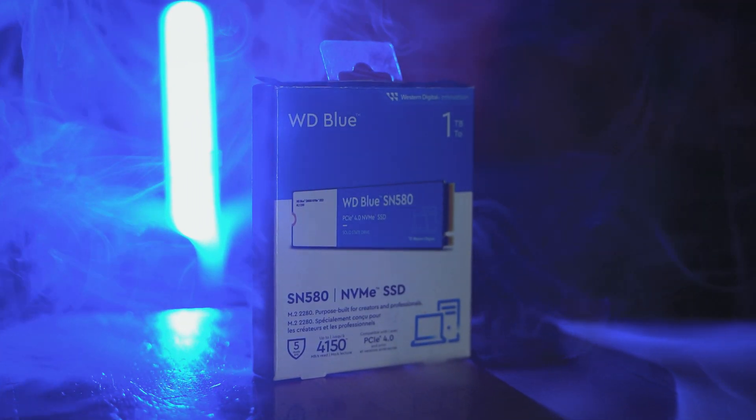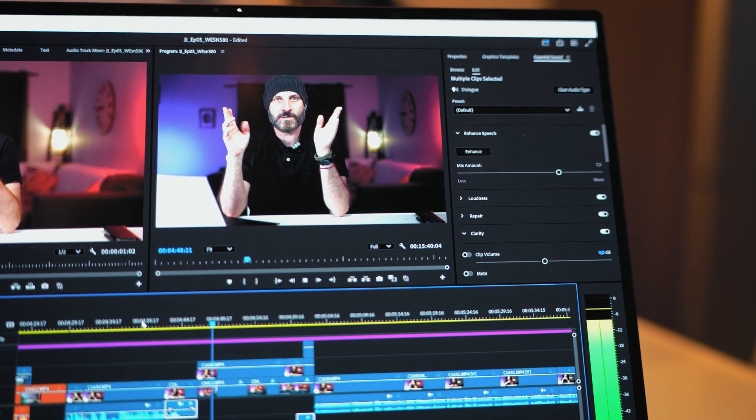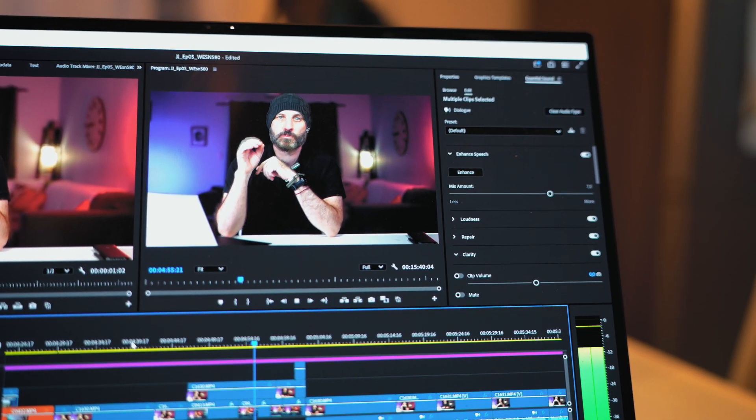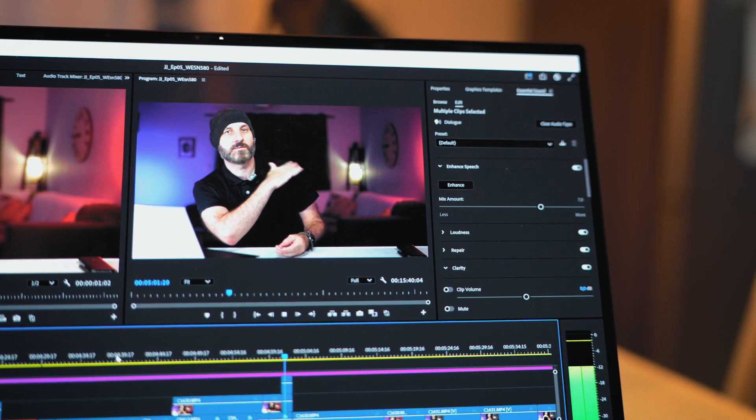Just a heads up though, PS5 users — you're out of luck. The PS5 is a bit of a snob and needs DRAM cache. When it comes to video editing, I edited this entire video on this laptop with this drive using 4K 10-bit 4:2:2 files, and the only thing that caused dropped frames was adding a LUT to the adjustment layer, which stressed the CPU. The drive itself didn't break a sweat. It's not going to magically make you a better gamer or content creator, but it will make your computer feel snappier, more responsive, and more enjoyable to use — and that's worth something.